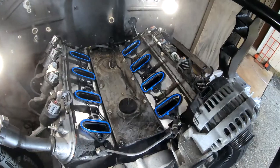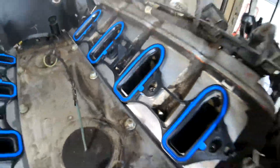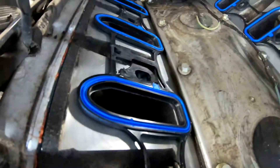Got all that stuff off — brake cleaner, spray it down, wipe it down. You can still see crosshatching in the cylinder. Everything turned out well. So the gaskets are on. Slight modification: my intake manifold does not accept the little notches and grab handles on the gaskets, so all of those are coming off — nice and ground down to perfection. Probably not supposed to use the angle grinder to grind down intake gaskets, but I did.